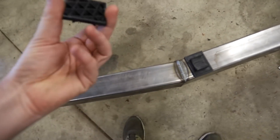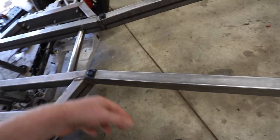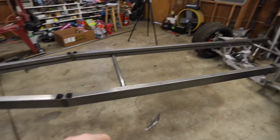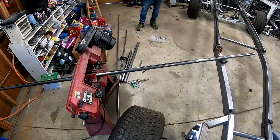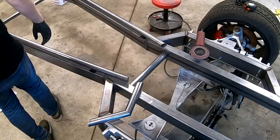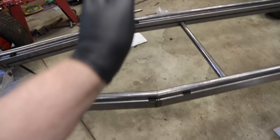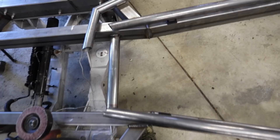I'm done with my little 3D printing project. These are tubing holders — they're 2 inches wide, so they set right on the center of our frame rail, and then the tube rests on there perfectly centered. Now all I've got to do is put those in the right spot, lay my tube on them, and it'll mirror these frame rails exactly. Next thing is to cut some tube — we've got four pieces to cut. We had a 10-degree angle here, and I did a bunch of math to make it all line up. Next I'll bevel all the edges so there's room for welding, then we'll start to weld it up.